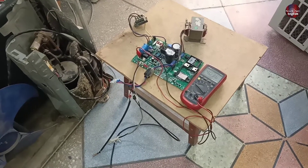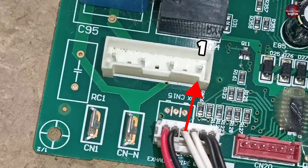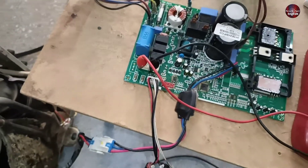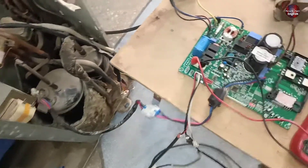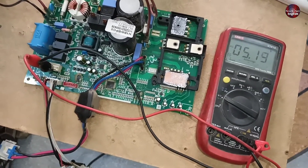Now I will perform some tests. Let's understand the connector installed inside the PCB control board. I am removing the probes from the connector to test it. On the connector, the number one wire starts from here, the second terminal is neutral, and the third and fourth wires — yellow and black — are for the speed. I have attached the red probe to the first pin and the black to the fourth pin. After starting the unit and the compressor, the voltage on the first and fourth pins of the fan connector is only 5 volts. Checking the other pin gives the same 5 volts, which means we are not getting output from the PCB board.